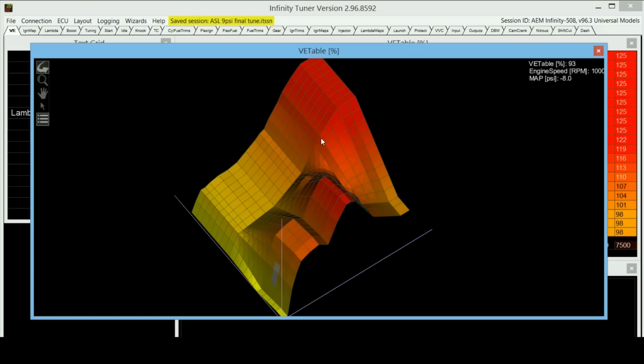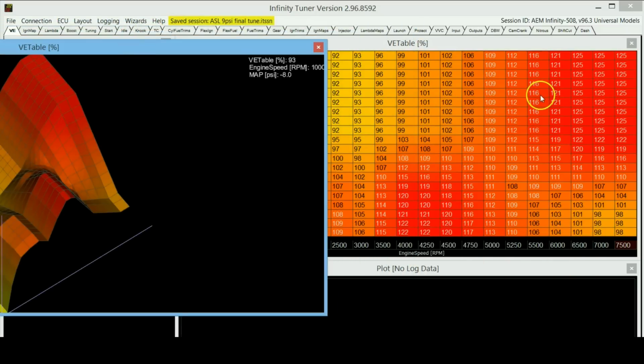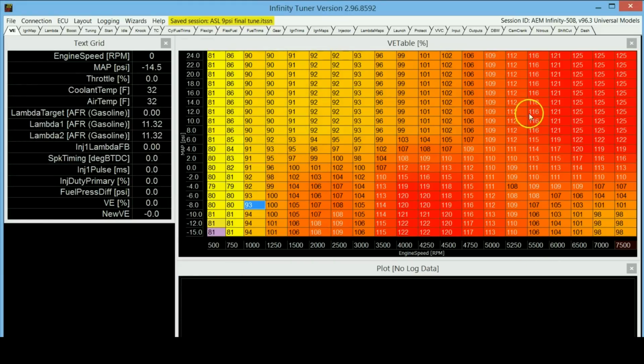in the higher RPMs. So the way my turbos are sized, once I step up the boost level, once I go to like 15 psi, hopefully my peak volumetric efficiency should come down to about 5,500 RPM. And that's exactly what I wanted to keep it at, because what that's going to do is that the usable rev range on the track is usually from 4,500 RPM to 6,500 RPM for this engine.